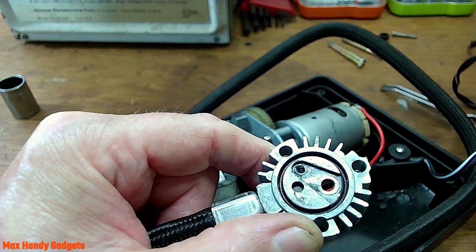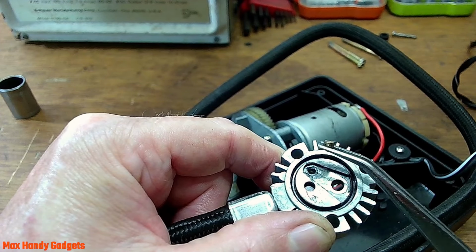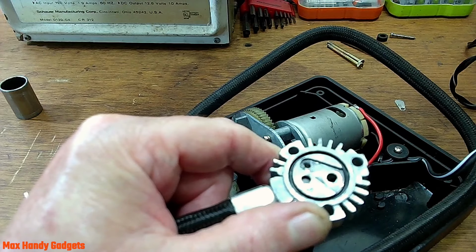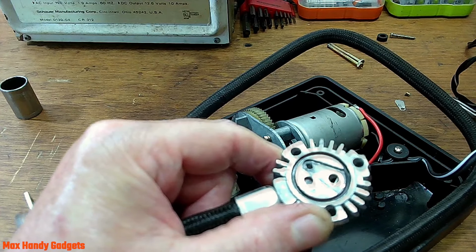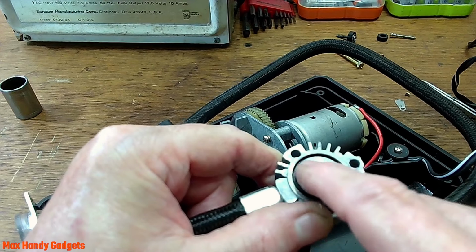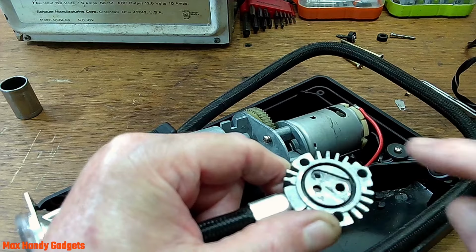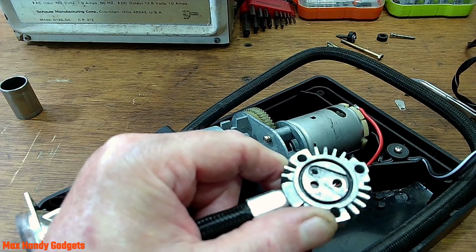Okay. So we're going to have to fix the valve because it's bent. And then we're going to have to find a way to put this rivet back in there or put a screw in. I don't have any screws that small, or that short. Plus it probably would stick in too far and hit the piston on the way up. That's not good. Yeah, okay, let's see if we can do something with it. Let me think about that for a couple minutes. Maybe we can lightly sand down the seat here for the valve, and over here maybe see if the rivet fits, and if it doesn't fit, we can make it fit by putting a little dimple beside it to close up the hole and possibly glue it in once it's tight. Okay, let's give that a try.